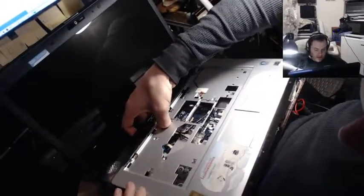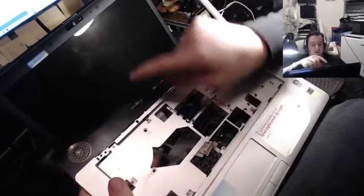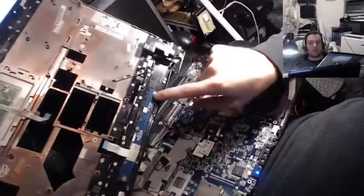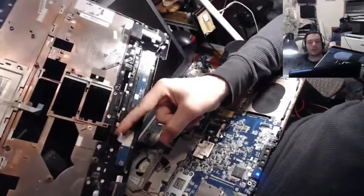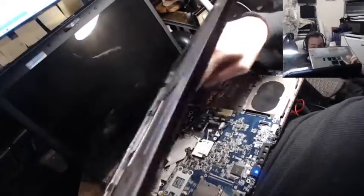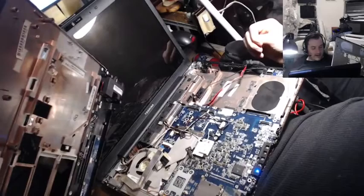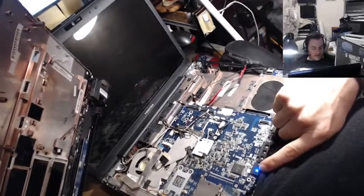I'm gonna try to start it. If I can plug in the... See, this thing's got the start button right here. And that's part of this panel, this blue circuit board, which has this connector. So I figure if I plug this connector in right here, I can press the power button and see if it comes on. It doesn't need anything else plugged in to come on. It already shows this motherboard's live.